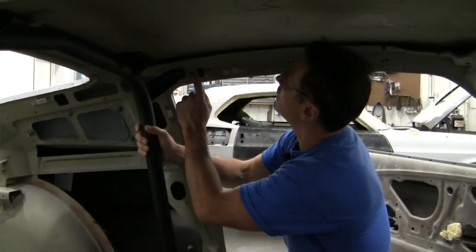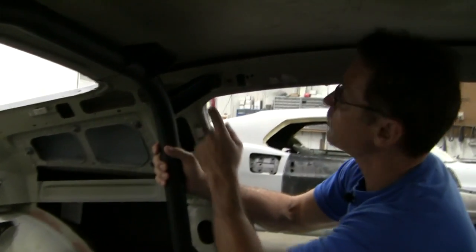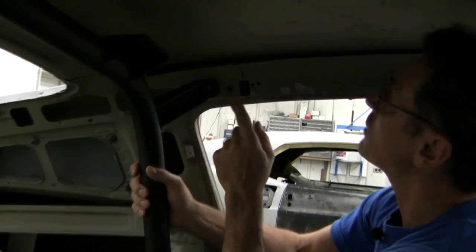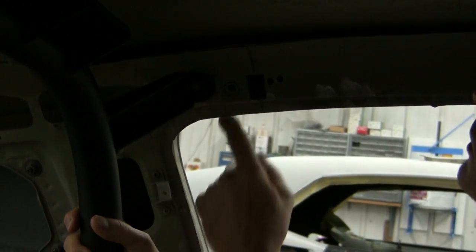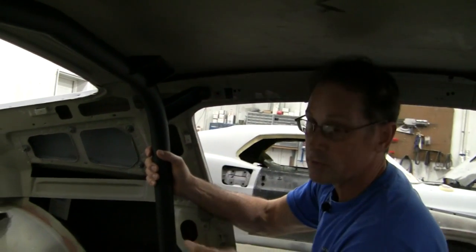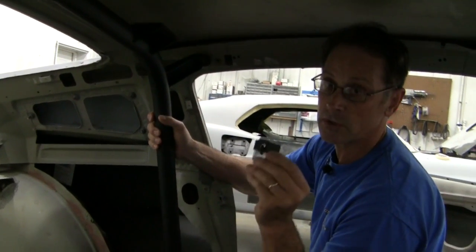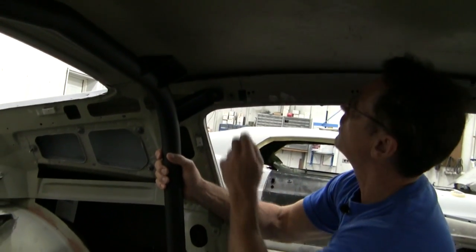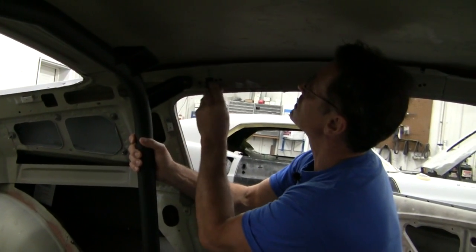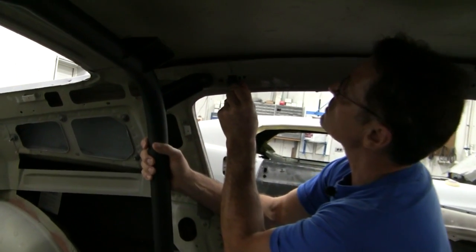Now if you had a 67 model, or even 65 — Ford was actually doing this — this is already notched out in here, there's already a hole here for an anchor. But they didn't start putting these anchors in unless you had the optional seatbelts in 67. All your 68's already had a factory anchor. Now if you do have the earlier years, what we do is we furnish you with a J clip, which is basically the same thickness as the anchor that Ford put in there. So all you have to do is literally slide this anchor in this slot, put it right in there, and that's where this roll bar is going to bolt. So that side is already fastened.